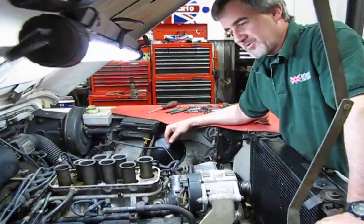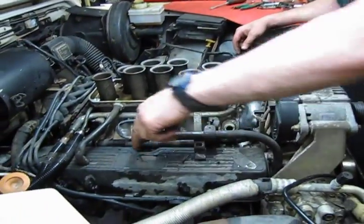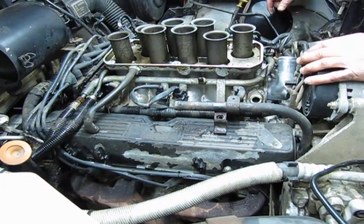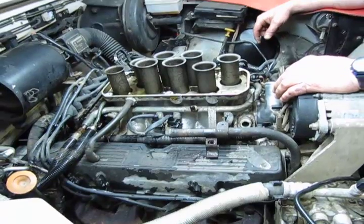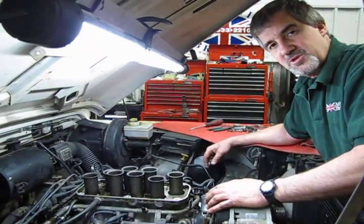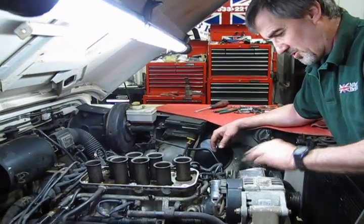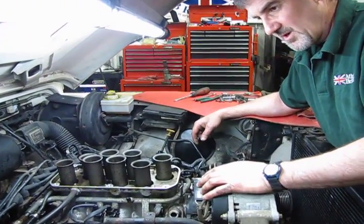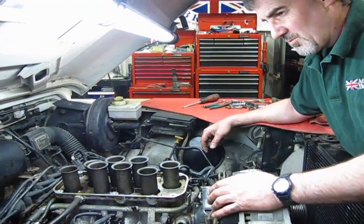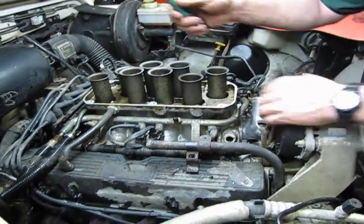Alright, so now we switched over to the passenger side. And as I mentioned earlier, we've already removed the heater hoses, which would run right across the top of this and then up into the heater core. So then that's relatively just unclamp and move. And we pre-drain the system. You can refer back to our video on the hose kit for this same vehicle, and that will show you how to remove the heater hoses and also how to drain the system rather easily as opposed to pulling the lower radiator hose. So where we are now is, next step will be PCV hose.